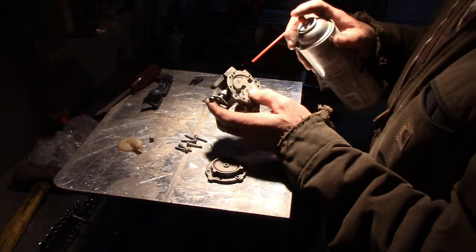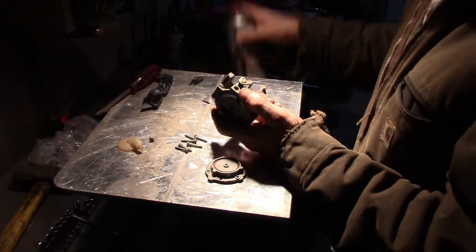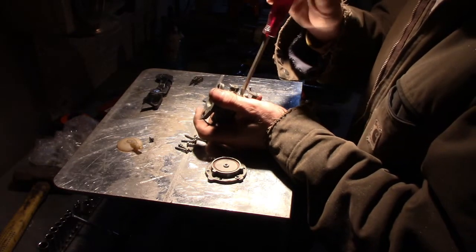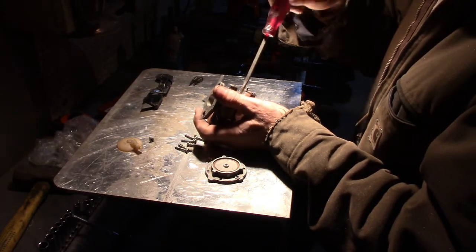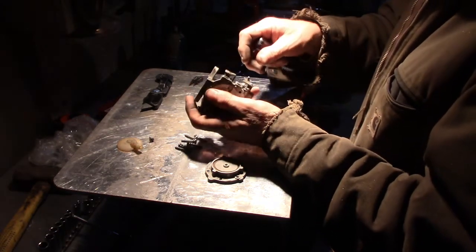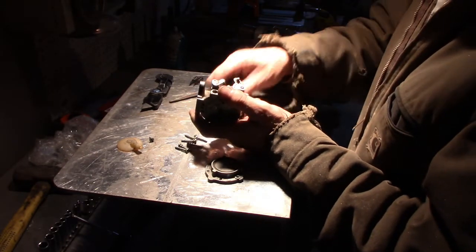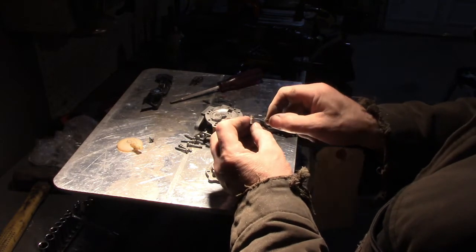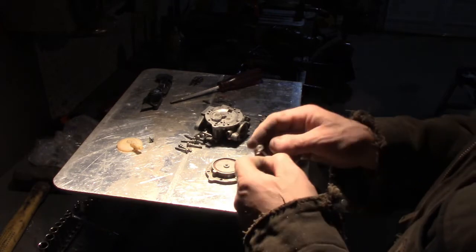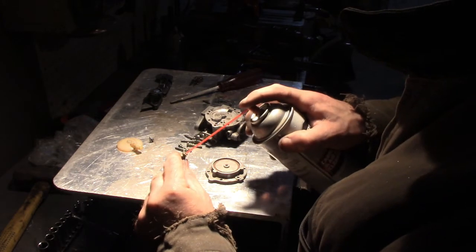Yeah, I'm gonna take this outside and blow every hole out that I can see. High speed, low speed, actually. Let's take this thing, I think this is a fixed screw. Let's see what's on there. Cleanable hole is what's in there. You know, you got them little holes that you gotta clean out. Now, there was a little ball bearing mechanism in there. That's what was the resistance.